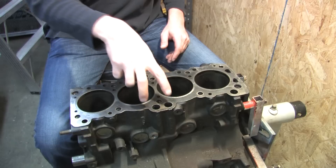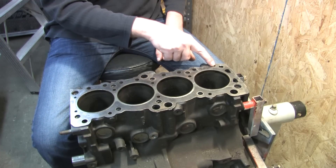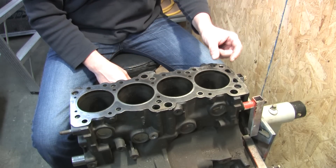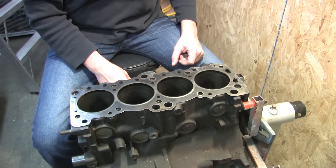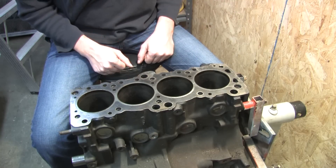All of the holes, with the exception of the big ones, are coolant passages. This one with the teardrop is the only oil supply gallery for the entire cylinder head. It shares duty with the head bolt hole, and the head is countersunk to allow oil to flow around the stud where it supplies the head oil regulator. That's what you have to deal with here.